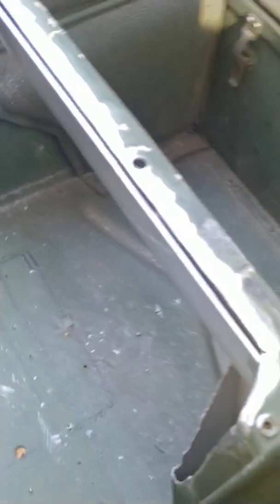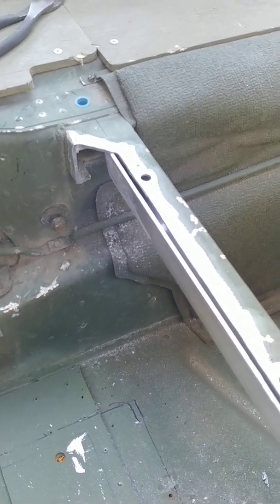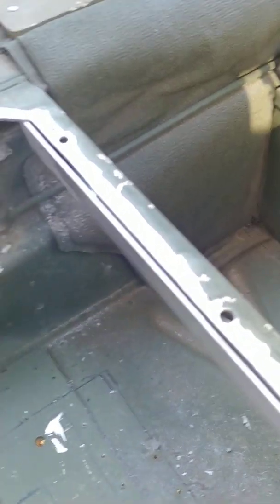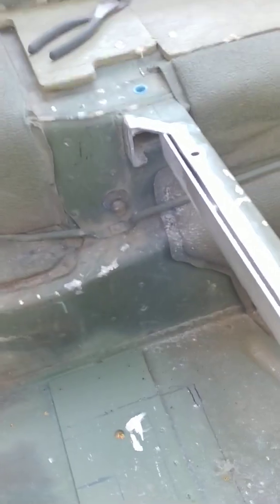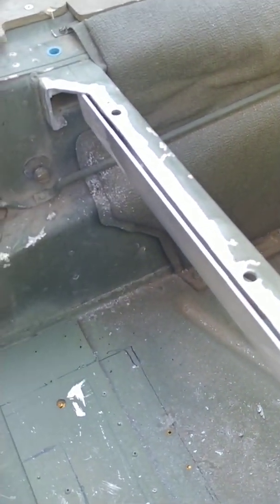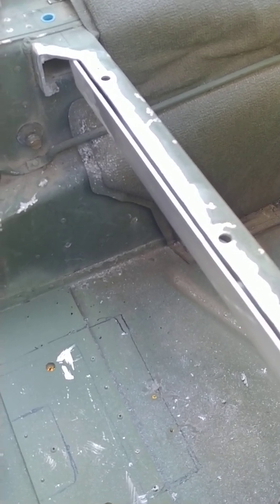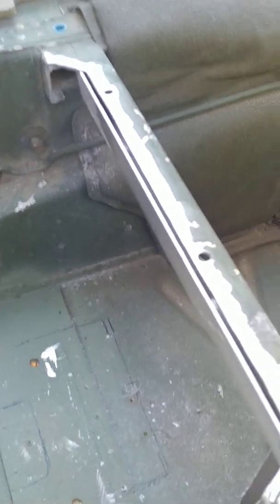That is what it looks like once you've cut this open — what you do is entirely up to you. I'm 5'9" and I'm putting in an aftermarket seat base. I cut about an inch and a half in; I believe this was three inches wide, and I cut it in half, so it's gaining me about an inch to an inch and a half. What it's allowing me to do is the new seat has a reclining lumbar, so it allows that seat back to recline, which greatly increases the comfort of the ride. Even if you can't get the seat super far back, it makes it so you're not up against the wheel sitting straight up and down. Hopefully this helps somebody.